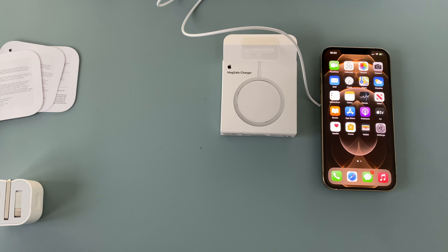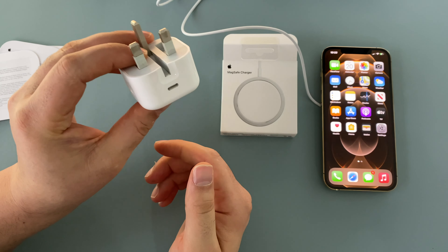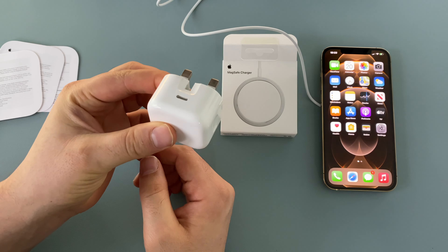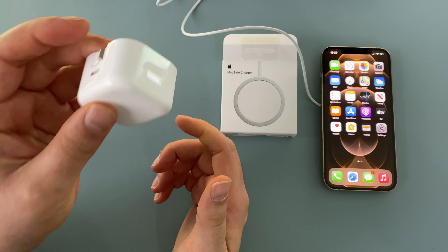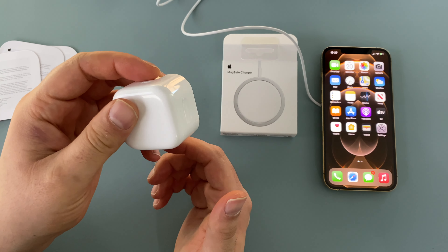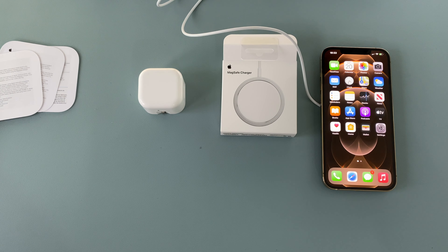The magnetic alignment experience only applies to the iPhone 12 and iPhone 12 Pro models — as I said, with my iPhone 11 Pro Max it worked but the magnetic option wasn't available. It's recommended to use this with the 20-watt USB-C plug here in the UK, sold separately, though Apple has reduced its price to £19 which is not too bad. Pairing them together gives you the fastest charging option of 15 watts.